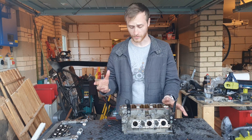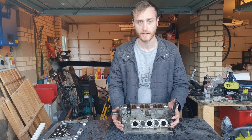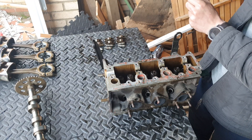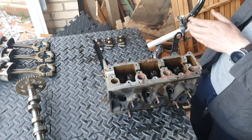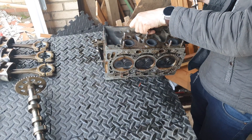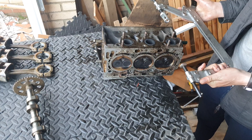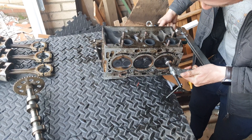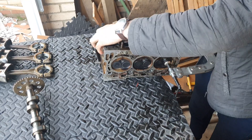So what we're going to do now is take a valve out and show you the assembly inside the cylinder head. First we're going to use our valve spring compressor. What this does is take the tension out of the spring so you can remove the little clips that hold the retainer on. The bottom piece sits underneath the valve so it won't just open the valve, and the other side sits on top of the retainer around the valve stem. Now that it's clamped down, we start to compress it.